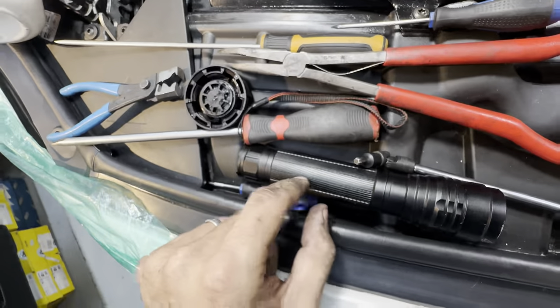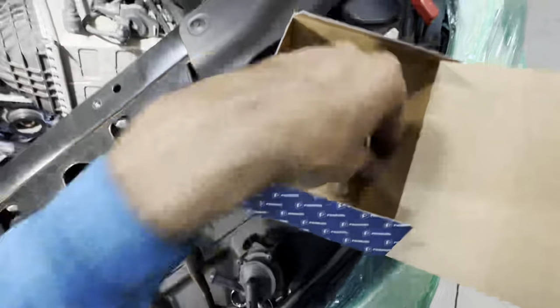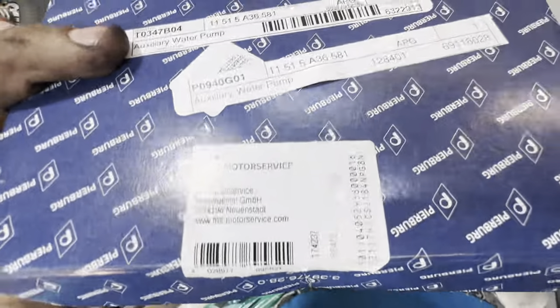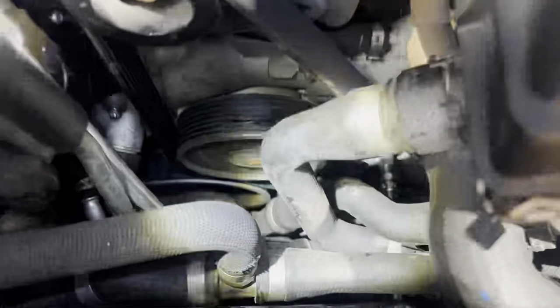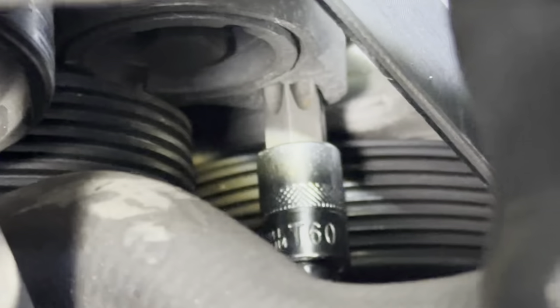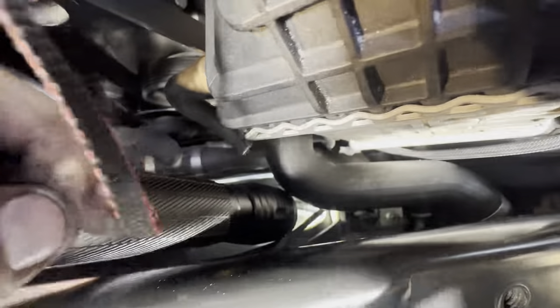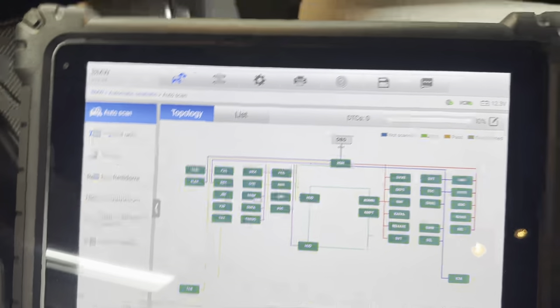You will not need the clamp tool unless you're using the original clamps — pretty much that's it. There's a bracket part number right there. Now we've got to put the belt on. The tensioner is kind of a pain but it's a T60 — you're going to use an extension to get a breaker bar in there. You can just kind of wiggle it in there, then pry the breaker bar all the way back until it hits this hose right here — it'll even bend this hose a little bit — and then you can actually slip that belt on nice and easy. The last thing you're going to want to do is scan the vehicle for any faults to see if there are any issues.